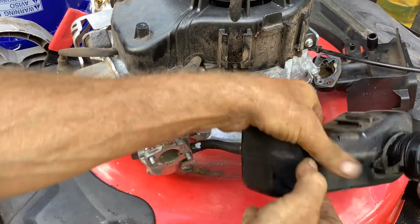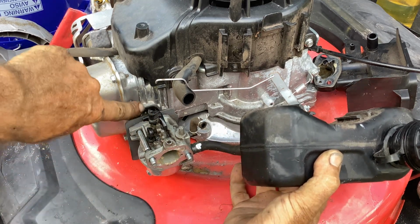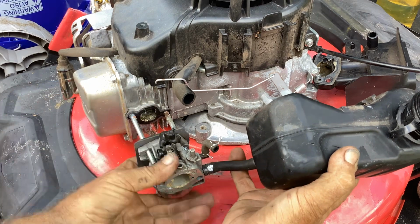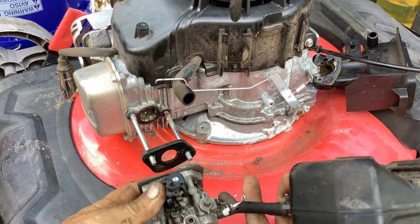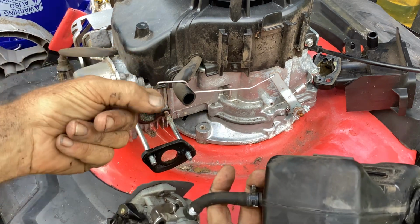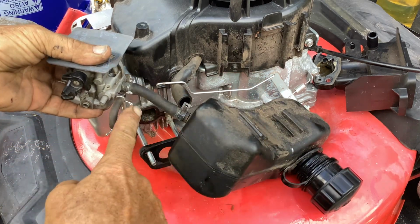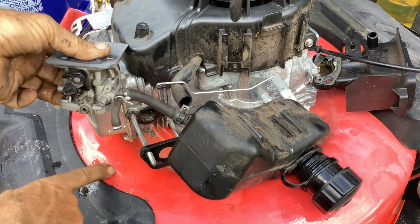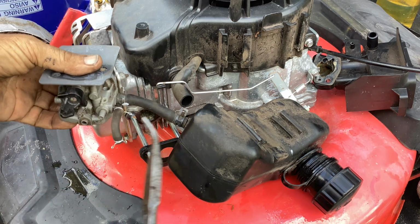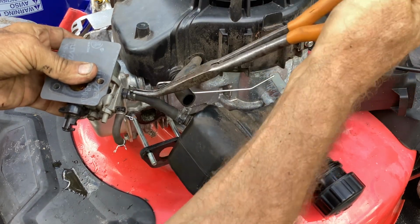So just by looking at it now, I can see there was a lot of water in the intake here. There's a bunch of yellow snot here, and there's a bunch of yellow crud back here. The two studs are rusty back there, so water's been sitting. Oh yeah, we might have to blast this out, remove the plug and get rid of all this water. It's just dripping out of the intake here. Let me use some needle nose. Yeah, water's dripping out of the carburetor. Rusty water. So we've got to look at the bowl. We might not even be able to do anything. This carburetor bowl may be an orange juice factory. We're going to find out.